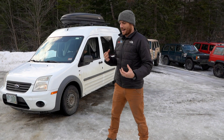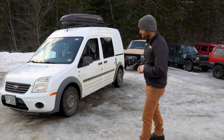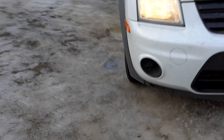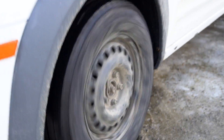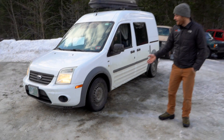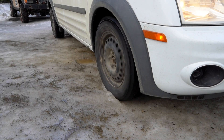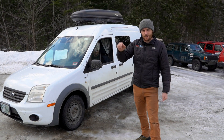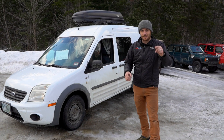We mentioned earlier different kinds of traction control. In the Fiesta it applies brakes to individual wheels, but we want to show you what happens in this Ford Transit van. He's full throttle the whole time. What's going on is he's full throttle trying to drive along and you can see it's cut the throttle - not to the point where he's really stopped, but it's not letting the tires spin much at all. When you hit the gas pedal, it sends an electronic signal to the ECU, which goes through a handful of different systems and decides whether or not to let the tire spin - in this case, it lets it spin just a little bit.